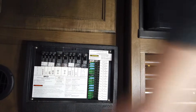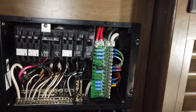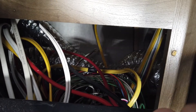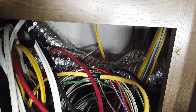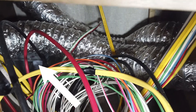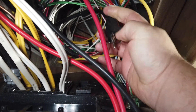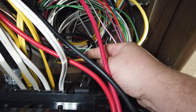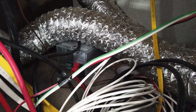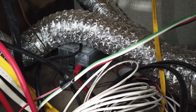We just got to take these four screws out. As you take those four screws out, there are four more screws on the sides to take the power distribution center out. In this particular camper, once we have that power distribution center out — it's not going to move far because of all the wires — but our converter is way back there in the corner under that pipe. You can see just the edge of it on the very left side, right under that vent, and you can see where the converter plugs in the back, which just goes to this breaker. Some older RVs don't have the plugs, but all newer RVs I think just have a plug where it plugs in. The issue is going to be getting to all those screws back in there holding it down to the deck.